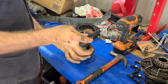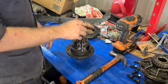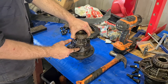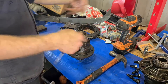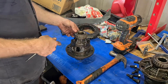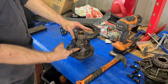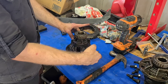This is where you find out whether your diff has been doing single peggers for the last two years or whether it's been babied by a grandpa. The gears inside here are not meant to have all the stresses of the motor screaming — they're meant to have both wheels spinning at pretty well the same rate like highway driving. But if you're just cooking a peg out the side of the local McDonald's or something, these gears are going to get hot — they don't have bearings, they're just sitting on the pins that run through.